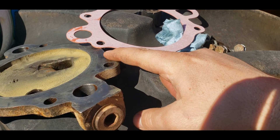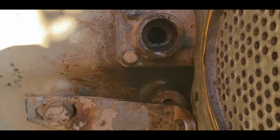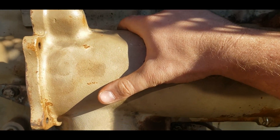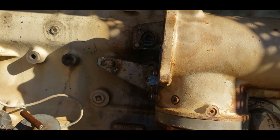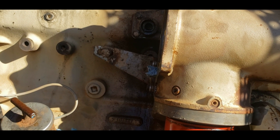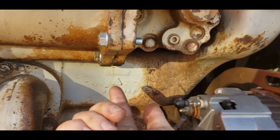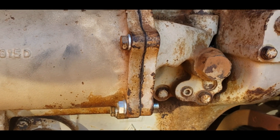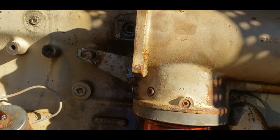I had this end in the backing plate instead of in the block — I'm not sure it should matter but I corrected it. I cleaned up the through-passage in there as best I could. My only guess for why it was leaking is that I had it in crooked, because I put the backing plate on first and then shoved the oil cooler in. I probably should have put the crossover tube in first and then put the plate on. I also forgot there was a brace back here that's kind of a pain to get on with the backing plate in the way.